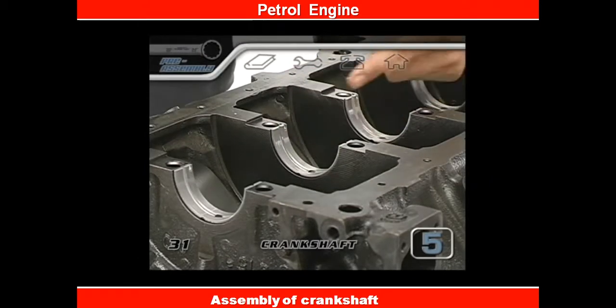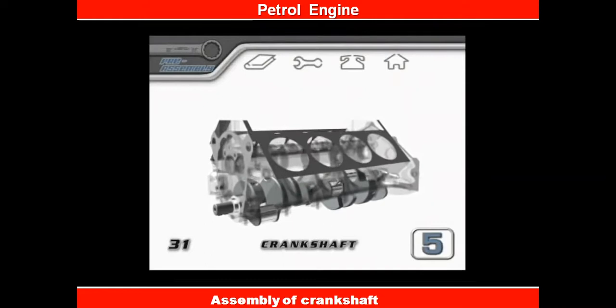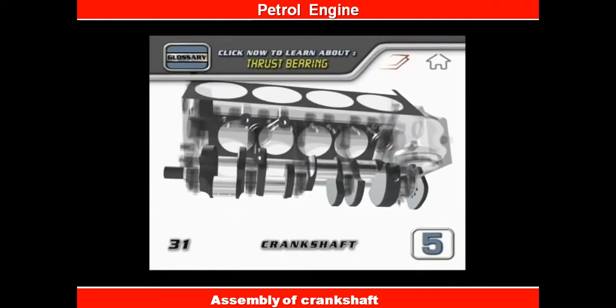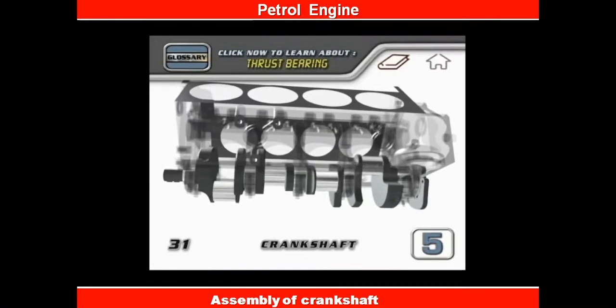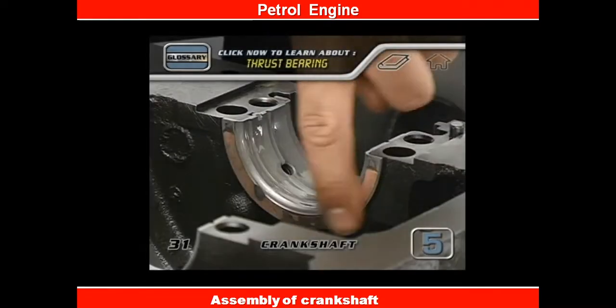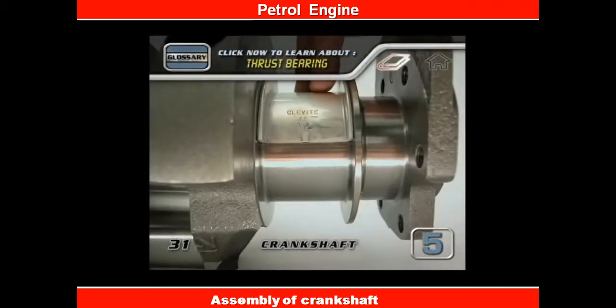You really don't want to lay a crankshaft on totally dry bearings. Every engine has one main journal that will have a thrust bearing installed in it. This bearing is the one that will limit the forward or backward movement of the crankshaft in the block. Make sure to wipe some oil on the thrust surface of the thrust bearing as well. The crank will be rubbing on the thrust face of the bearing at these two points.